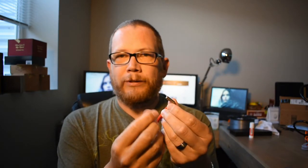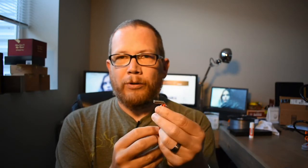The repair is going pretty well so far. I didn't stop to show the heater cartridge replacement, but it was very simple and straightforward. This is the old one, and this is the part I got from Prusa — they sent it out because my heater wasn't working. The heater block is just a little clamp with a little screw. You loosen that screw, the cartridge slid right out, put the new one in, tighten it back up. I had to clip the zip ties and re-zip the wire bundle. On the other end there are two little prongs — the connector on the control board has two screws. You loosen those screws, pull the old ones out, put in the new ones, retighten the screws, plug it back in, and the heater is working now.